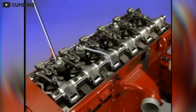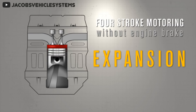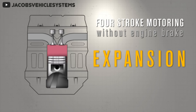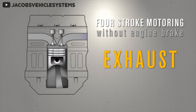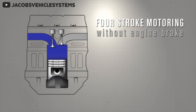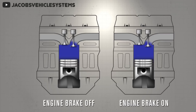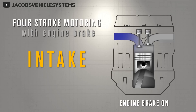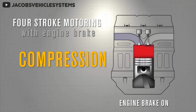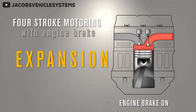The big change comes between the compression and combustion stages of the engine's operation. During compression, the air being compressed is pushing back down on the piston because it doesn't want to be compressed. Ordinarily this doesn't matter because the combustion stage creates more than enough force to overcome this resistance. But what if, instead of combusting the air, we fully harness the resistance of the compression cycle and then let it out of the engine before that air spring has a chance to push the piston back downwards? To do this, the jake brake simply opens the exhaust valves near top dead center during the compression stage. All that compression force pushing back down on the piston ultimately slows down the engine, and then that air is released before the piston begins its downward cycle.